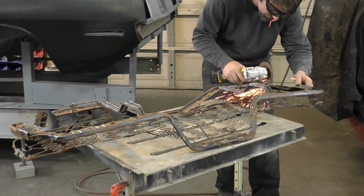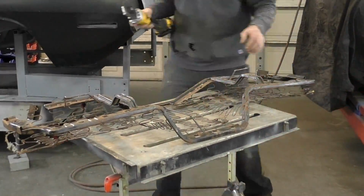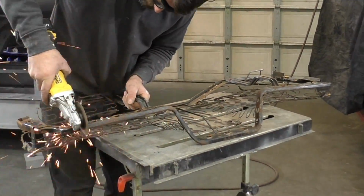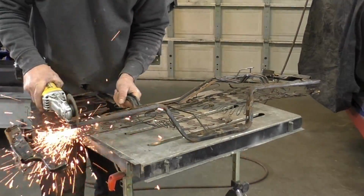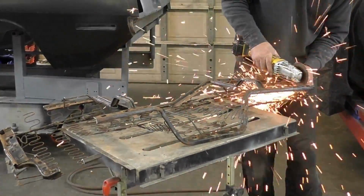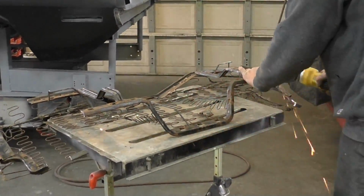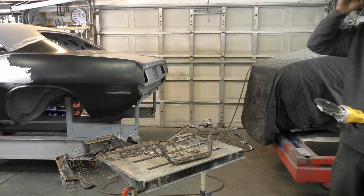The top springs are still at the same location, so the seat should look the same there. And then when we're wrapping the cover, now that they're both cut evenly, we should be able to wrap the seat around without as much bunching up because the front's not pulling tight and the back's looser. This has come from trial and error and just making something better from issues we've had in the past.